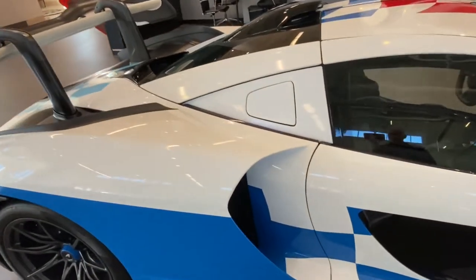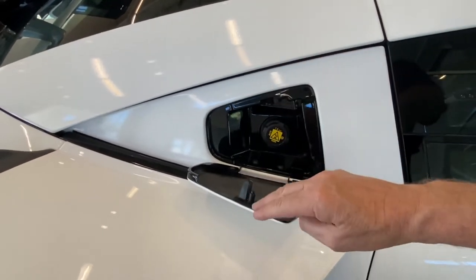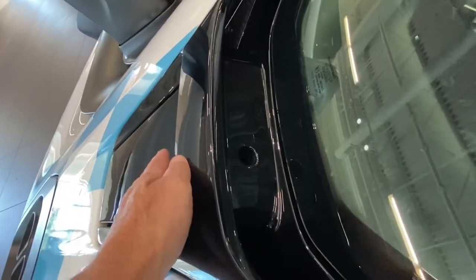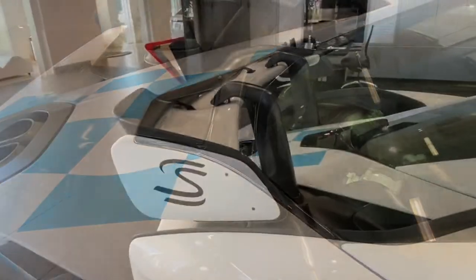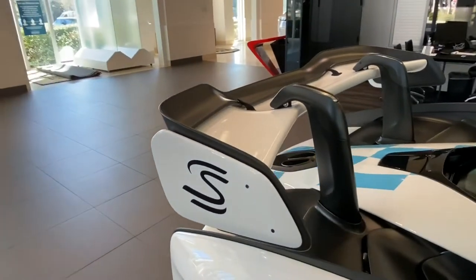With this crazy carbon fiber structure, servicing is an issue, so they've given us little hatches. This one opens opposite to the fuel door — this is where you add coolant. The carbon fiber structure is so light you just flop it back and forth. For oil, there's a little door in the back here — in your tool kit comes a carbon fiber screwdriver to open it, the door pops up, and you can add fresh oil through the back.